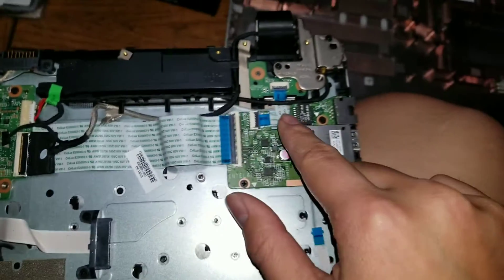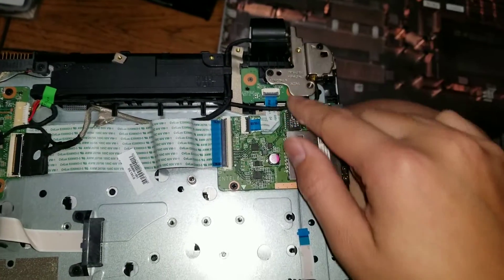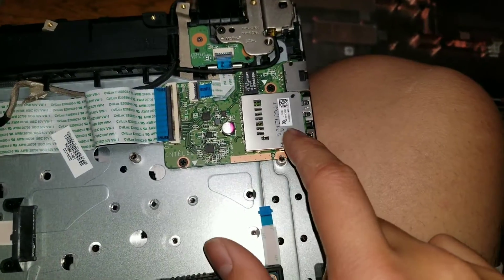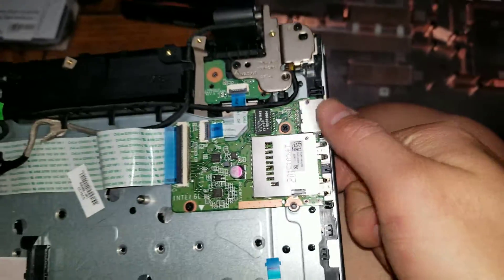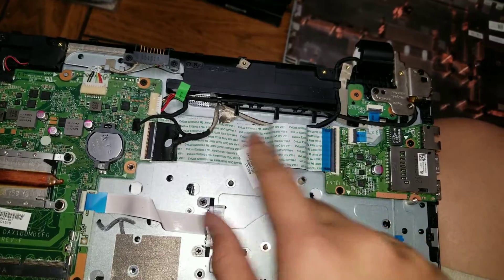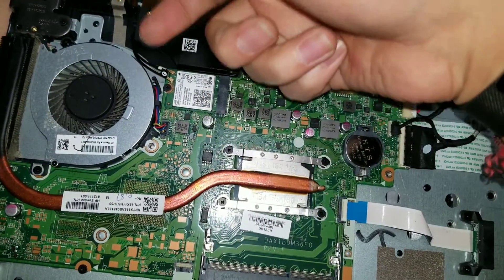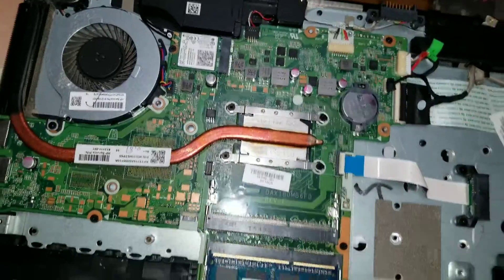The charging port cable curls around and goes all the way under this, so you have to take the hinge out. I believe this is the power button, so if you need to replace the power button board, you can. There's the SD card slot and two USB ports, and the ethernet is also on a separate board with this cable connecting it. Then the LCD connector and the fan and the wireless cards — same as other ones, you just pull those cables from the back and it'll pop out. To put them back, you just snap them back down.